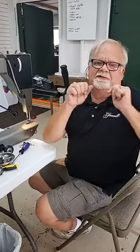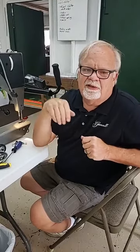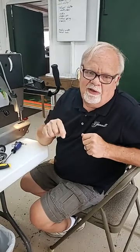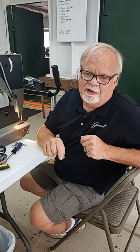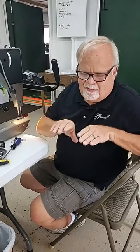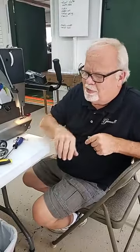A lot of you sew on your sewing machines, your domestic sewing machines, right? And you're just zipping through those strips at 90 miles an hour. A lot of people don't realize though, when the needle of your sewing machine goes into that fabric, your feed dogs go down and that fabric isn't being advanced. So that fabric is actually doing this, going through, even though it feels like it's nice and smooth going through. It's really not.